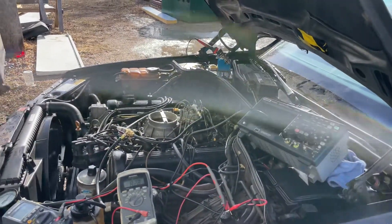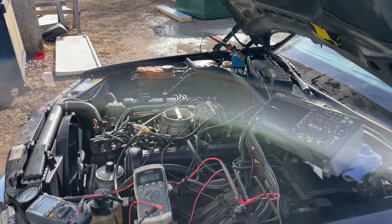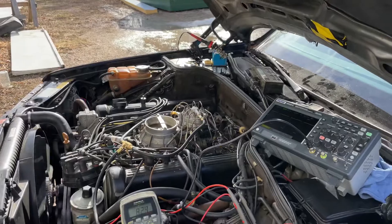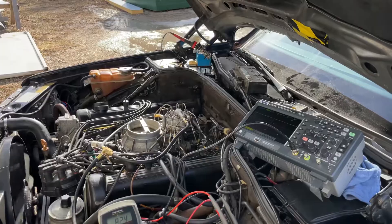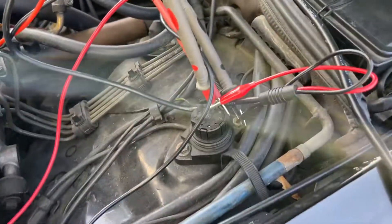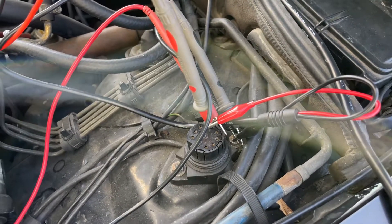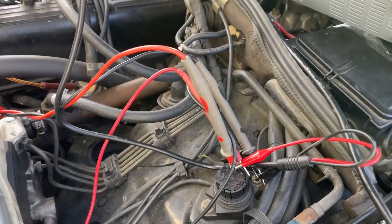Good afternoon. I wanted to touch base today and show you this on the car — how this works with duty cycle: the negative duty cycle or off part, and the positive duty cycle or on portion. Right now I have all three meters hooked up to pin number one, terminal TD, which is the RPM signal of the engine. It's running somewhere around 650 RPM.